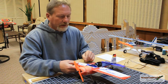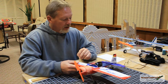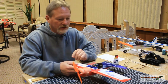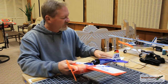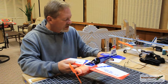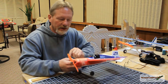The original upgrade with the RacerStar BR-1306-3100 kV motor and the 40-45 prop gives a 1.4 thrust-to-weight ratio. With the 5x3 prop that's on here now, you get about a 2-to-1 thrust-to-weight ratio. I checked my batteries when I came back — my longest flight, with my timer set for 3 minutes, was 3 minutes and 40 seconds, and the battery pack still had 7.6 volts, or 3.8 volts per cell. So even with the 5x3 prop, you should be able to get 6 minutes of flight time out of this plane.